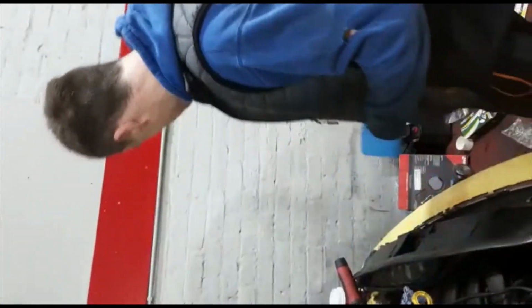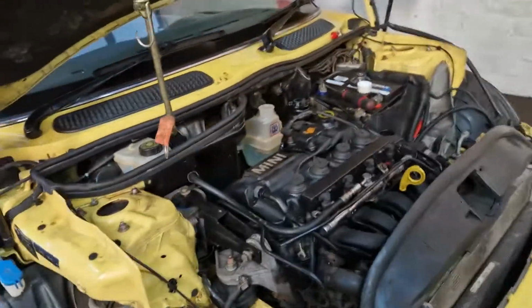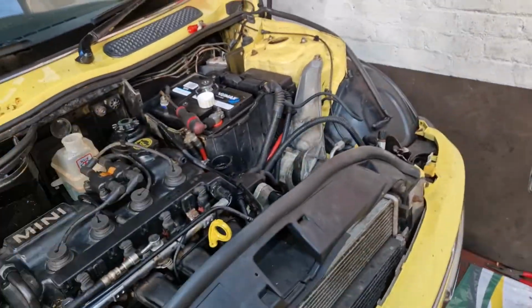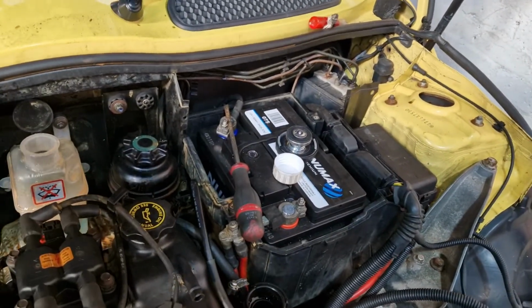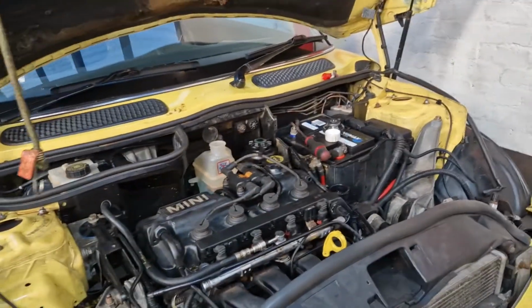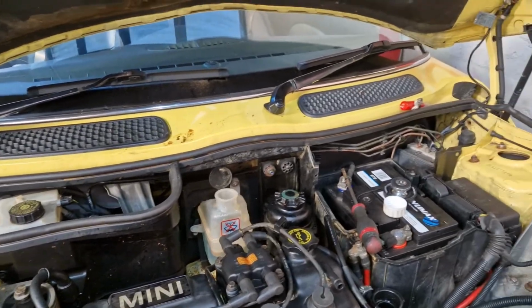There's also the bolts for the chain as well, which we'll just nip down in a minute. So a wee Mini, I put my engine lifter there, used for lifting the BMW engine out of the van the other day. We just need to tighten that up, put some coolant in it. I've not put strong coolant in it now, we're going to drop it all out again. Obviously you've seen all the rust that's in the system. So we're going to run it up to temp, see what happens. It was spewing coolant out about 10 minutes before we took the head off it. Now that it's all shiny new, everything's basically new. Head gasket, bolts, all the gaskets, thermostat, everything. So we'll see how it goes.